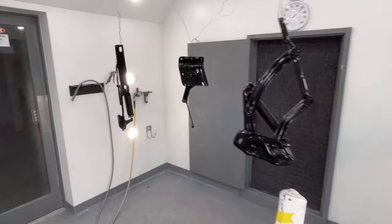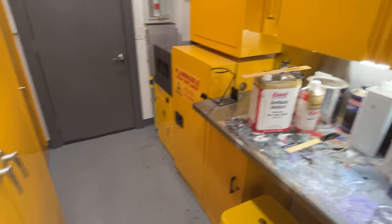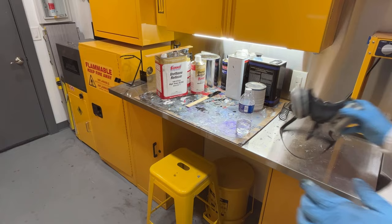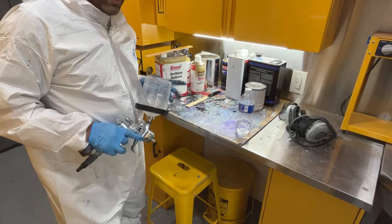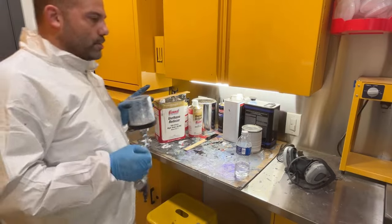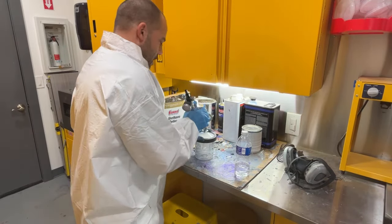the heater, and we'll take a look at it after it's been heated up for a little while, because that's going to really start showing how it dries. Now, Summit Racing Paint, this brand here, they don't recommend a bake cycle. They don't even have instructions on baking it. But if you use it with their shiny clear, with their regular clear coat, you will have a problem. I've done it. It dulls up really bad, and it almost looks like it gets solvent pop in it.